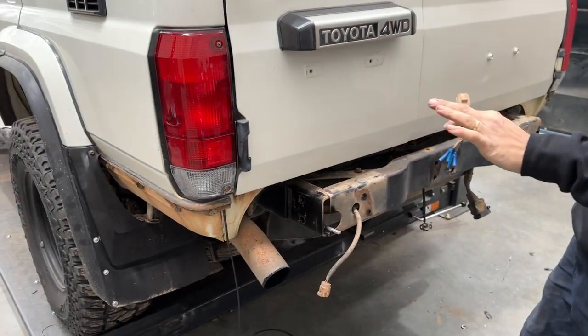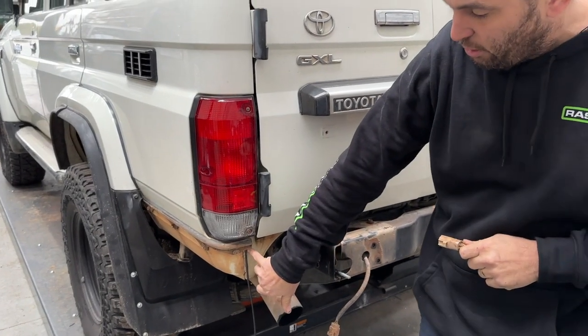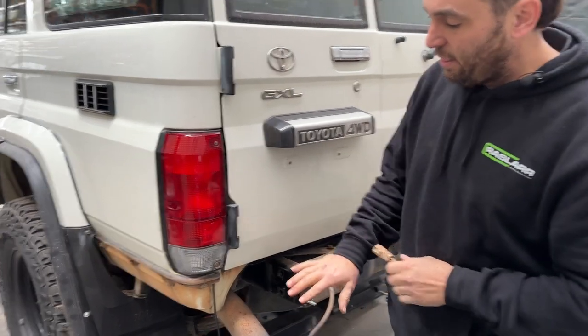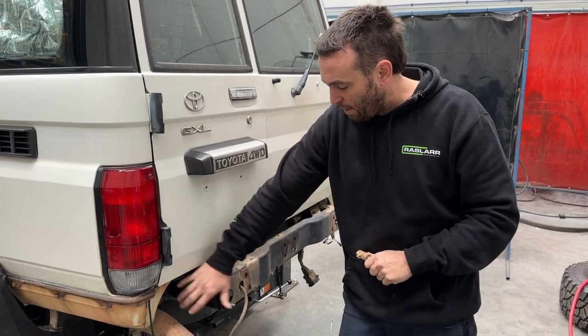You can also drill a little tiny hole in the bottom of the tail light housing and tap into reverse, because you are going to need a reverse signal. These are all the things that are nice to do while there's no bar on — open the holes up, nut-on-a-stick in there, sort your wiring out. From there the car is ready to go.